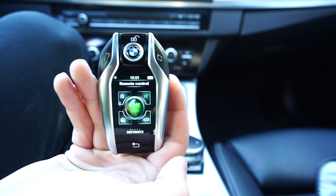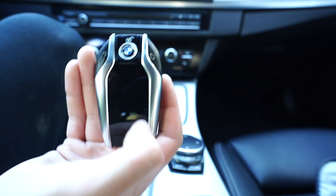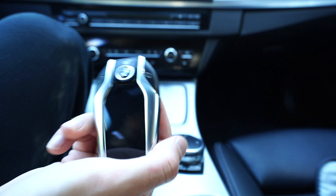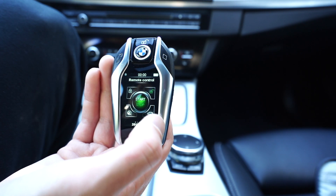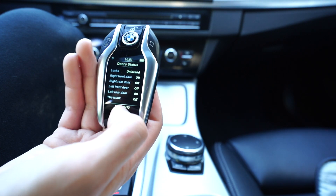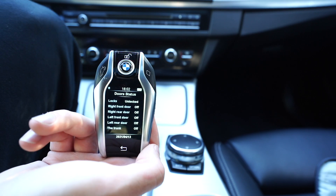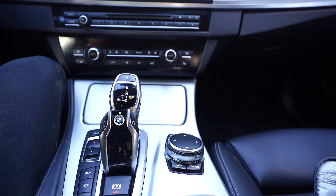Comfort access works with this key in my pocket even when the whole unit is shut off. If I shut it off, nothing happens when I press buttons on screen, however you can still lock and unlock the car like a normal key. It's a smart display key - it doesn't have an insane amount of features but it's pretty good for what it is. I'm happy with it. It was very easy to program to the car because I have the tools, but if you don't have the tools you'll need a locksmith or someone with professional tools to program this to the CAS module, and you will need a working key.